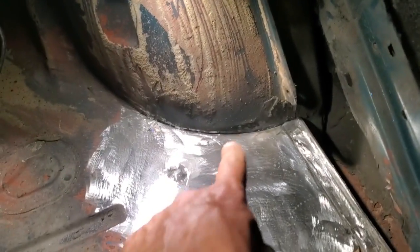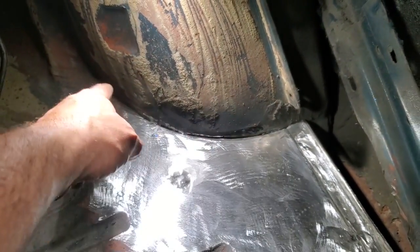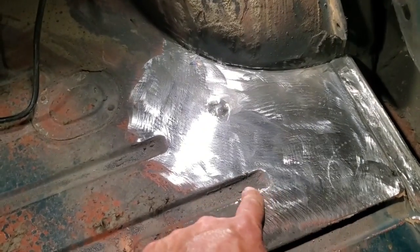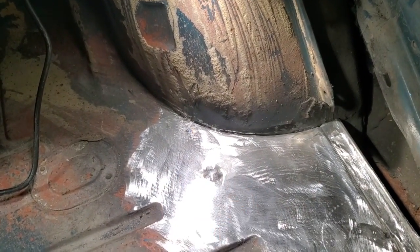So there it is now, all welded up along there, everything's pulled in, fits nice. It's got a nice seam down along there now, so when they seam seal that there and down here, it'll look original. And I got the little button in it and everything is flowed in, all the original beads and everything are there, and so it's a nice job done on it.